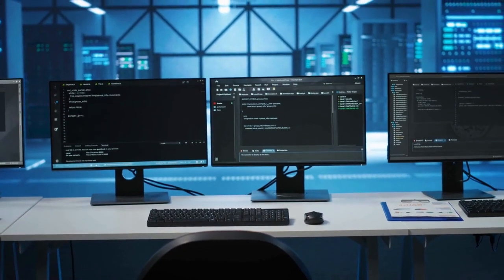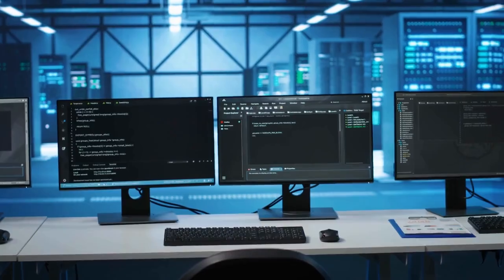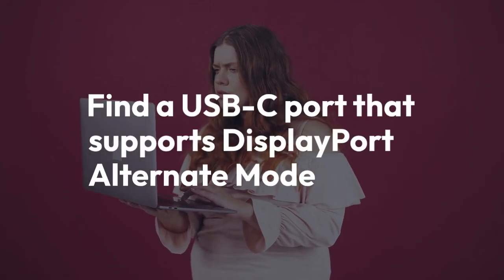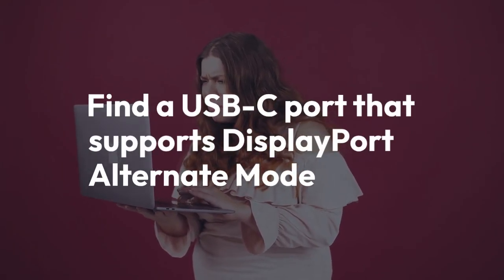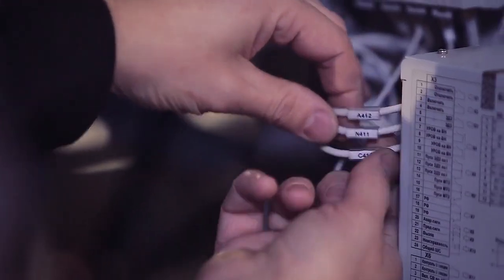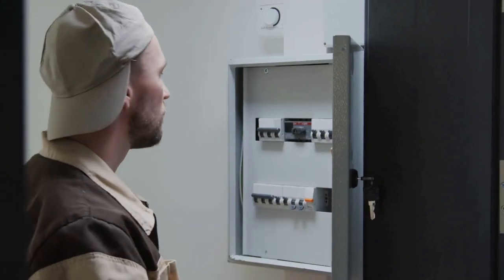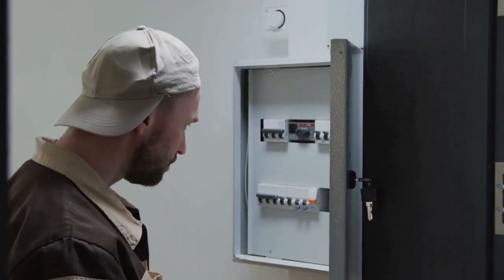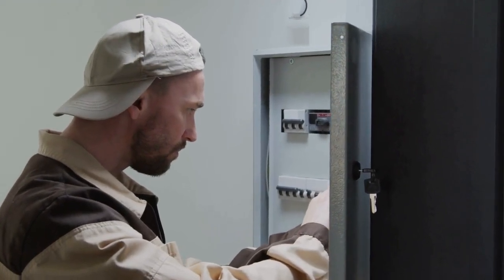It's usually marked with a DisplayPort symbol — a stylized logo of a small square with some arrows. On your computer, find a USB-C port that supports DisplayPort alternate mode, or DP-Alt mode. This is important: not all USB-C ports support video output. Often these USB-C ports with DP-Alt mode capability are bigger and sometimes have a lightning bolt icon next to them, or are colored differently.